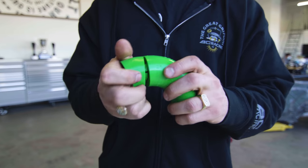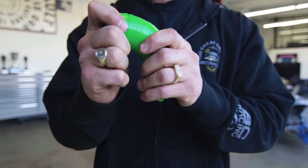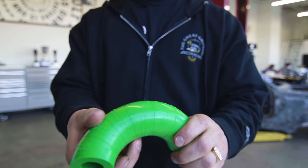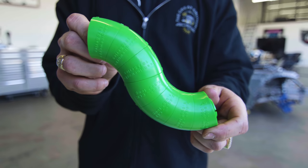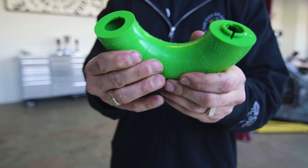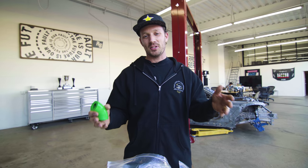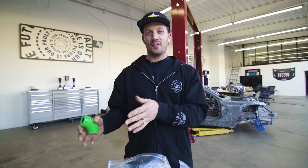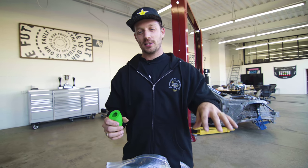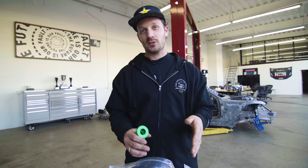And also just get Dom a perfect idea of how these headers are gonna be designed, because we have to do 26 inches of tube per header, or 26 inches of tube per primary. And 26 times 5 all the way through is gonna be over 11 feet of tube on each side between the engine and the front frame rail. So there's not a lot of room there. And on the driver's side, we have the accessories like the alternator on the side of the engine and also the steering shaft coming through. So there's almost no room.